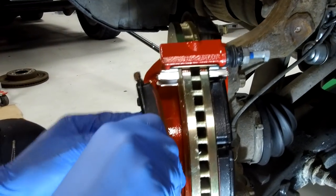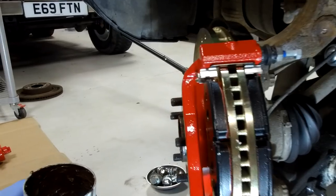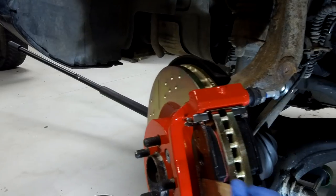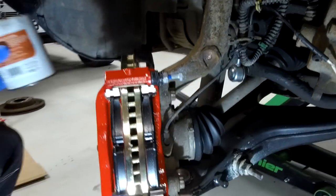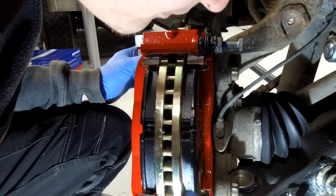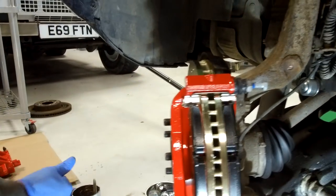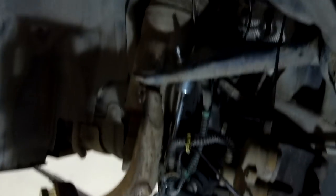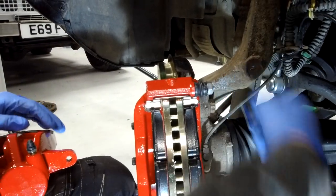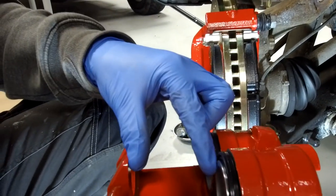The painting isn't going to make it brake any better but it looks nice and clean while we're doing it. A little bit of copper grease - whether it stops squealing I don't know, but there's no downside to it. It's supposed to stop the brakes squealing. We're putting it in the middle and both ends where it contacts the piston side - just around the periphery. Try not to get it all over the brake discs obviously, so put the copper grease on afterwards. At this point you'd unclip your cable ties holding the caliper, swing your old caliper back on and bolt it on, but obviously we've got our new caliper to fit.